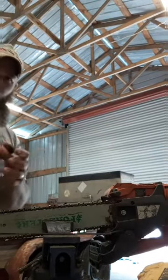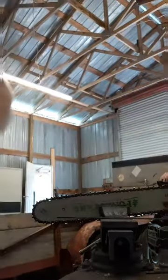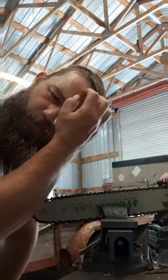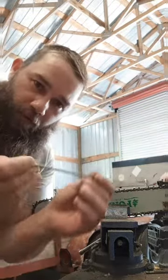The thing is, it's a semi-chisel chain, right? What we're talking about now on this top end of saw. The thing you really have to do on a semi-chisel chain, this saw is pretty already sharp, is something you don't want to get out of the routine of doing if you sharpen chains a lot and you pay attention, and that's kind of watching the working corner. You kind of don't look at the working corner here, because there's really no working corner. So you focus on the depth and angle of your file. You know what I'm talking about?